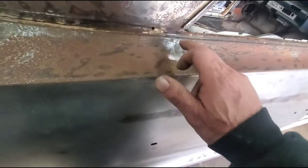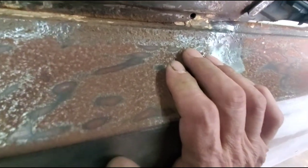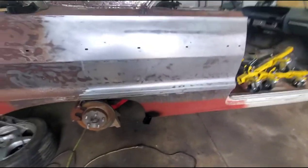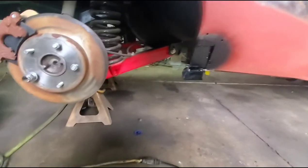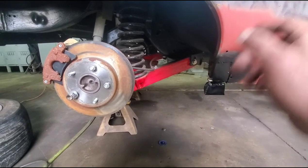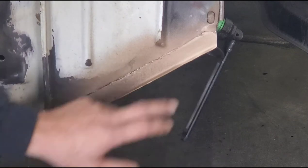While I was at it, we had that crack up here on the quarter — that's now welded and ground down, all the body lines match. There's a lot of pitting going on up here; my guess is they plan on doing a butt-load of body work, but structurally that's done. The procedure is the same as any other sheet metal welding: a series of tack welds until they're all closed in, then grind it down and move on.